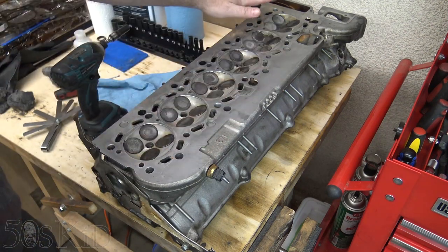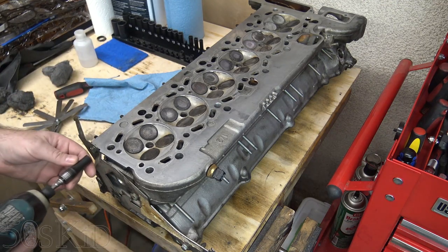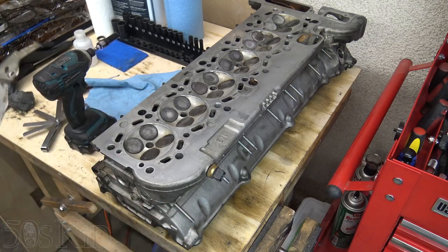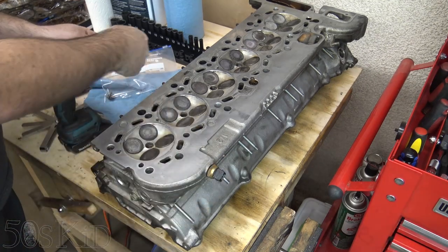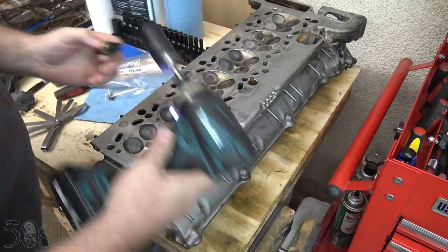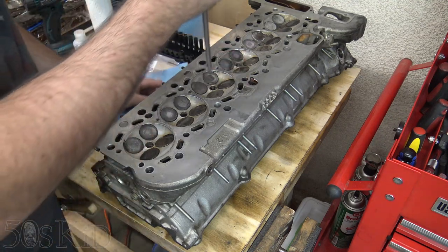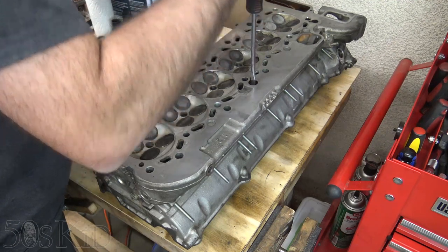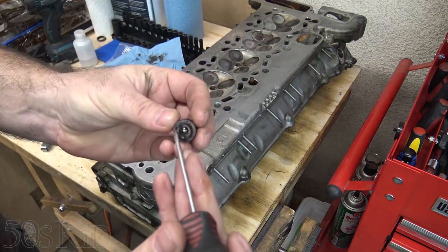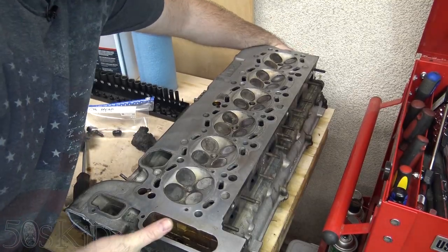I did get the surface clean. I want to get this plate off the back here — it looks like it's just two tens. I'll bag those. I also want to get this coolant temperature sensor off the back — it's a 22. I remember I already cracked it free a while ago. Another thing I want to take out right now is the check valve — the anti-drain back check valve. The only reason I want to get it out is so I can clean it properly. As you can see, it's just a little spring-loaded ball bearing. Doesn't need to be replaced, just needs to be cleaned out.